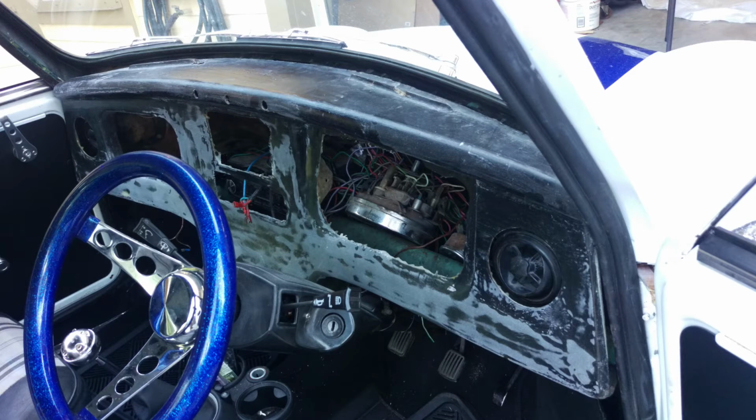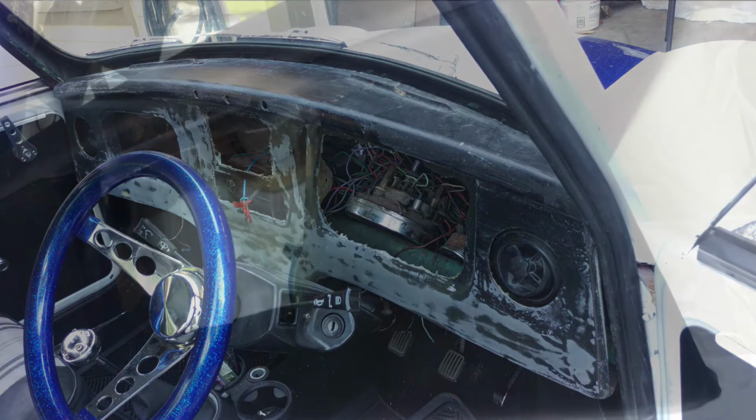I cut out the entire gauge cluster and switch plate areas because I'm going to use a piece of ABS plastic on top of this to create bezels to fill these back in. I decided I'm going to upholster the dash in vinyl, so I run a stitch seam horizontally across the vinyl fabric to allow it to bend around the bump in the dash.